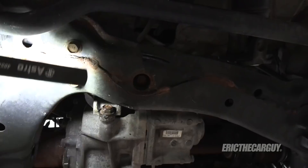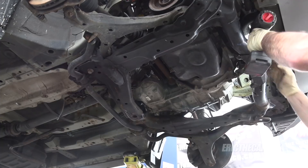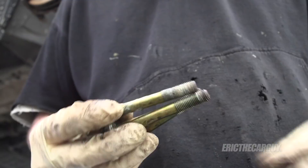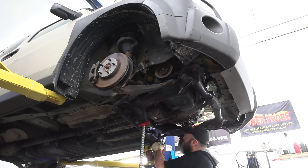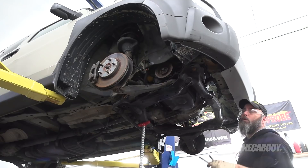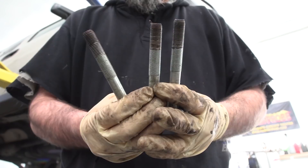This rear engine mount has three fasteners — one there, one there, and one in there. The front mount has a through bolt, so I'm going to remove those now. To remove the subframe completely, there are four fasteners. Keep in mind the engine and transmission are still held up by the side mounts up there, so removing the subframe they're not going to go anywhere — they will flop back and forth and you've got to be careful of that, but as long as those mounts are still connected you shouldn't have anything to worry about.